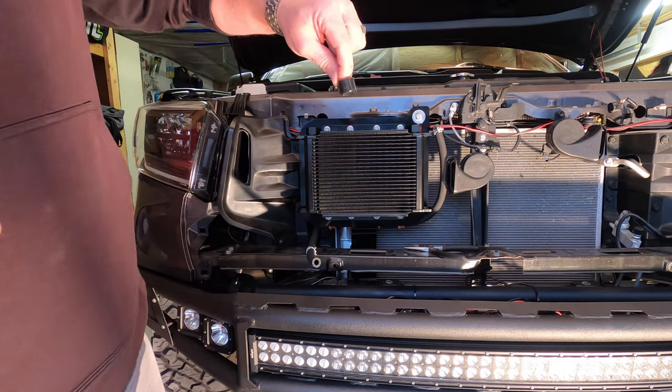We'll take it for a test drive and check for leaks. When you're done with the install, make sure you leave the grill off, go for a little ride, come back, and check for leaks. You want to check anywhere you were dealing with — anywhere there's a hose connection to any kind of fitting, the thermostat area, the transmission area — just check everywhere and anywhere you were working. We took the truck for a little ride, left the grill off, brought it back to the garage. No problems at all, no leaking anywhere. If there's no leaks, you're good to go.